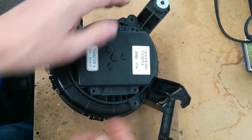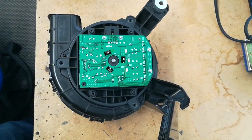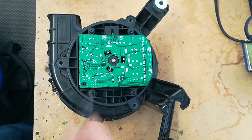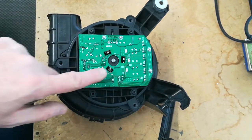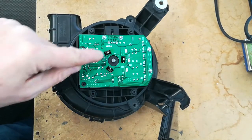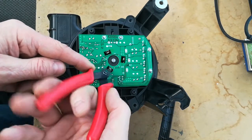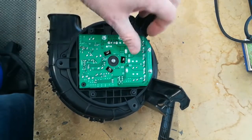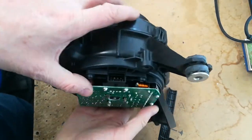You can take the whole module out or take the back off. With the back off, you can see this is a three-phase module with three connections to the fan. These are made by spot welding, so they are incredibly difficult to get apart — you can't unsolder them, though they can be soldered back once repaired. What I did was prise them gently, then get strong snips in between the two and cut through the spot weld, which freed up the tabs.